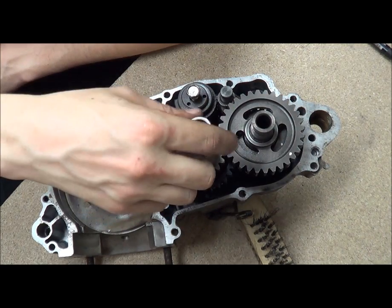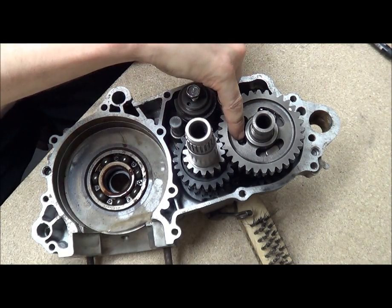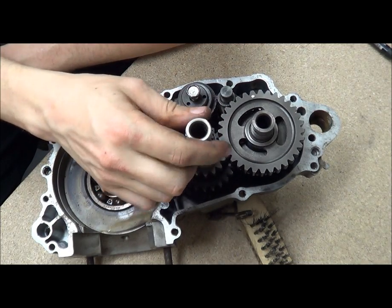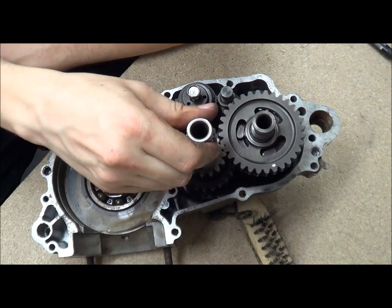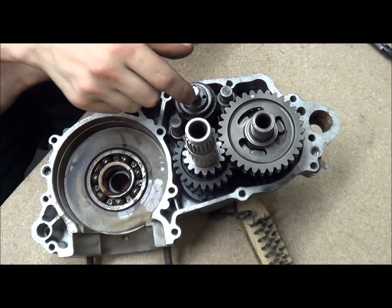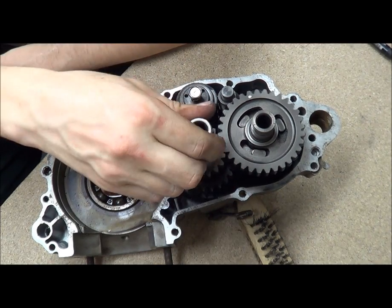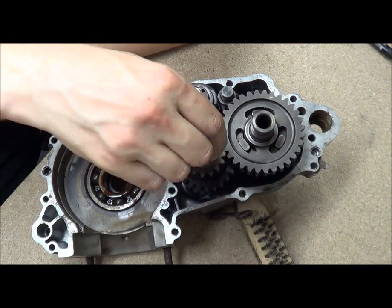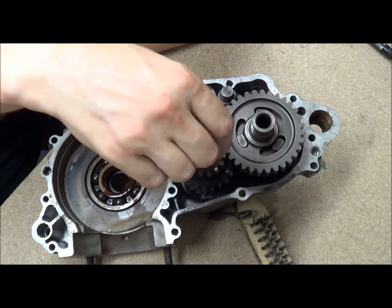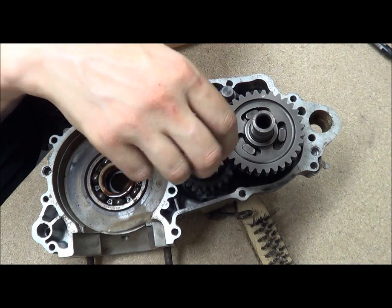Here's a good thing - if you look in this gap you can see how this gear is spinning but the dogs are spinning at a different speed. That's because that gear isn't selected. So I know that that's first - see how that dropped into there.